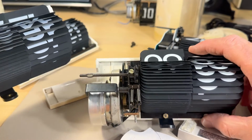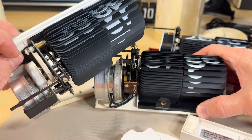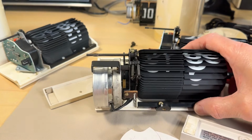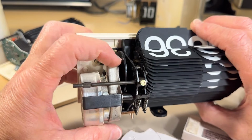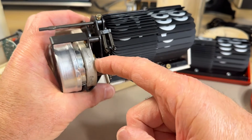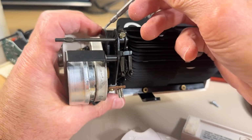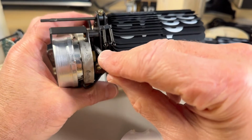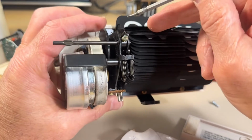So it's a difference in advancement, the way they advanced it. You see here on the newer version, it's using a plastic gear that moves plastic here, and then you've got plastic here. But in the older version, you've got a very similar thing where you've got this thing here, which happens to be metal, that moves the gear down. It's pushing, I don't know if you can see that. It's rolling around on this wheel. Normally, it's pushing down with this diameter. There's a divot there, so that when it hits that divot, it's going to release this arm, which has been held back, and push this forward.